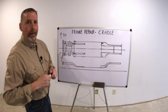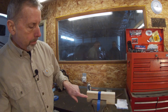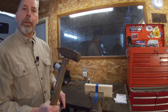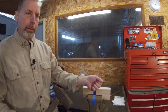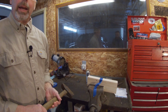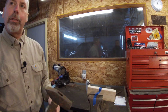I'm going to show you a quick demonstration right here, and I hope it'll convince you. This vise here is the frame on a car, and this is the cradle. A piece of tape on there just so you can see how they line up — those are bolted tight together. This hammer is going to represent either the force of the impact from the collision or the frame machine pulling it back out. On your frame machine, it's just pushing and pushing, and I can't get that to budge. But that's not how it got hit. When it was going down the road, it got hit in a nice hard shock, and that will cause that cradle and frame to slide. You can't push it back no matter how hard you push, but that sudden shock is what does it.